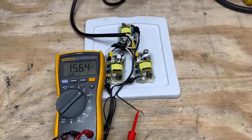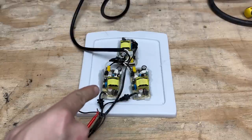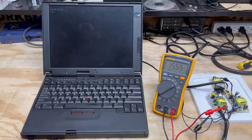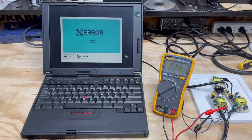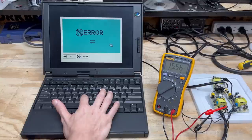We're at 15.6 volts, which is close enough. And rest assured that once I receive the correct power supply for this laptop, I'm sending this thing back to the depths of hell from which it came. Triple-checked the polarity on the barrel connector and we are good — let's see if we can send this laptop to a low earth orbit. Here comes power. No voltage drop so far. And it does power on. We are angry — errors 161 and 163. I'm pretty sure one of those means a bad CMOS battery. Does it have the flappy bird mouse cursor? Yes it does.